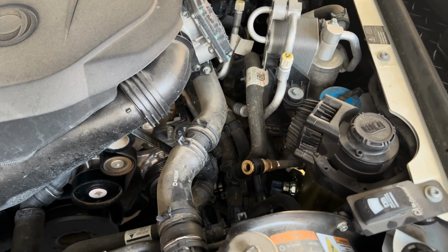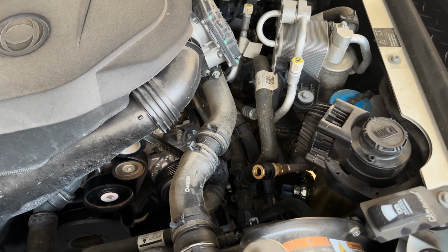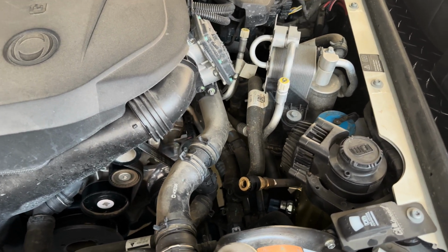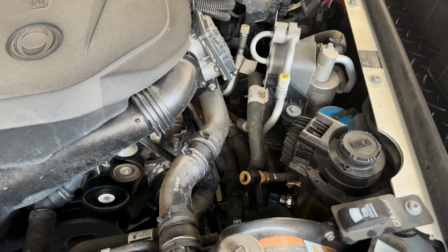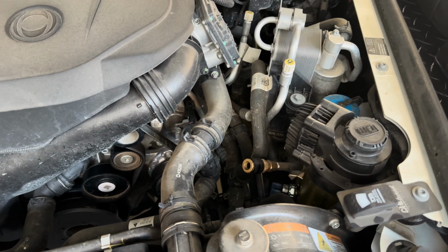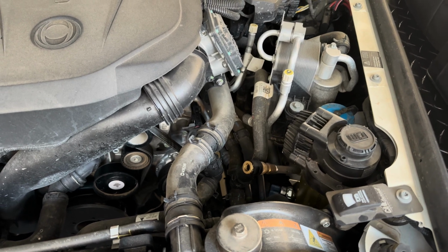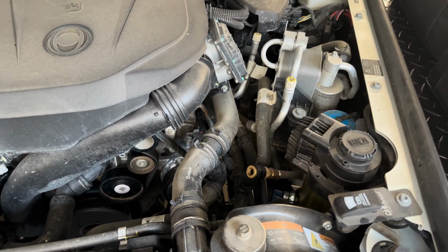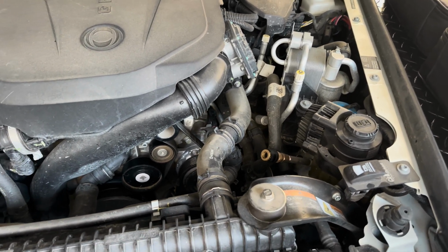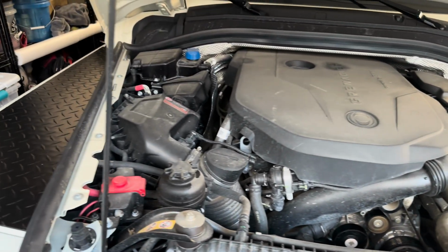I don't think I really have an issue with engine heat. A lot of people complain about that. I've run compressors in the past in the engine bay with no issue. Same here. I've used this thing probably 20 times after trails, and it holds up fine, does great. It fills up pretty quickly for my needs, maybe 2 to 3 minutes per tire, going from about 14 psi to 35 psi, so that's pretty good. I'm not really pressed for time on trails, so the speed doesn't bother me.